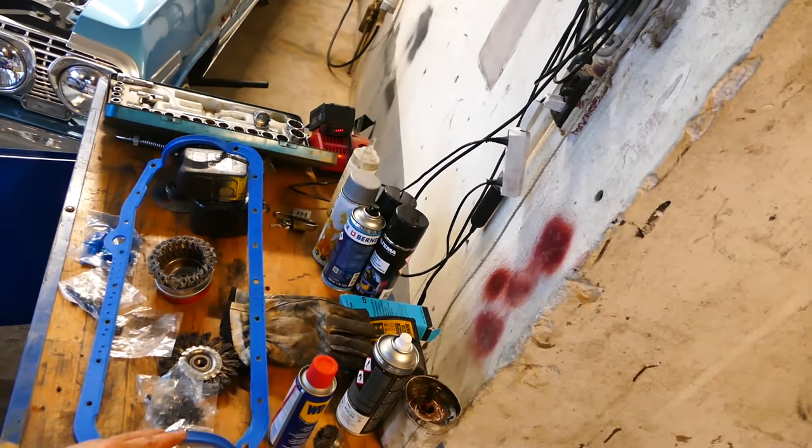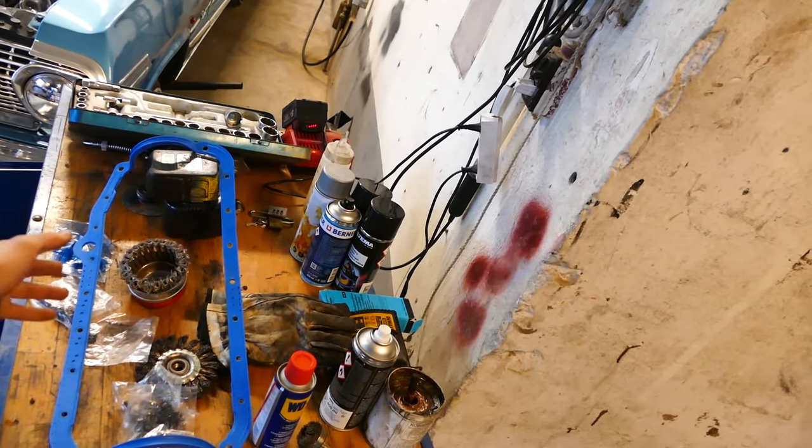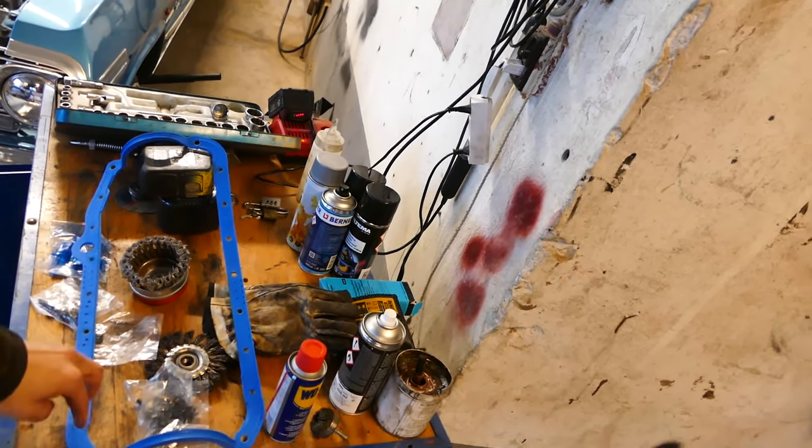This thing right here is a one piece rubber gasket with I think like an MLS type of steel core inside, which is really damn nice, from Fel-Pro, and I think it was only like $28. It comes with new bolts, new washers, and the gasket itself is just way nicer than the two cork gaskets and the rubber strip and stuff like that. Plus, you can actually torque them down to spec without the cork squishing out or anything like that.